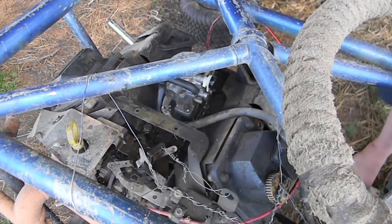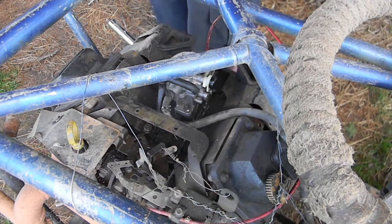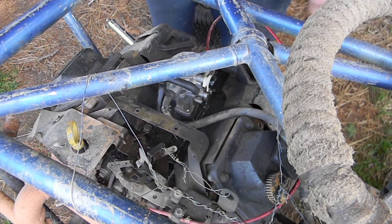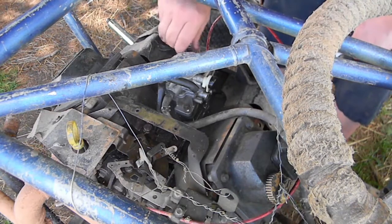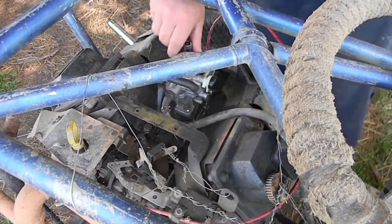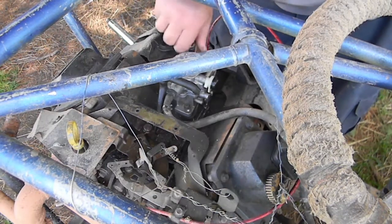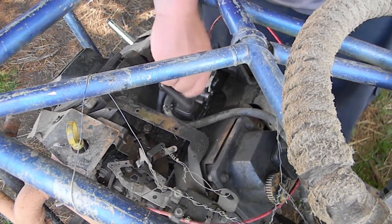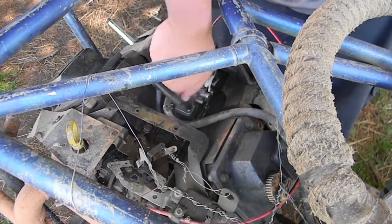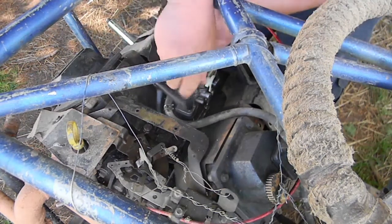I didn't do that with Dinky. I did release Dinky's tire pressure, but if I go too much, there start actually being ripples in the sidewalls, and I didn't like that. I figured, considering the speeds Dinky goes through, that having ripples in the sidewalls would just be a whole bunch of friction on aging tires and all that heat. I figured it would cause a failure, and I have had enough failures on Dinky for a while. I'm not trying to go through any more money than I have to. I've got some plans for Dinky, I just don't have the money for it.